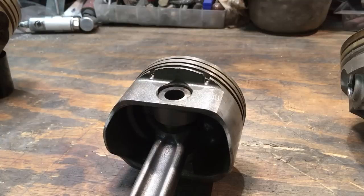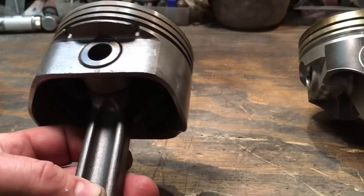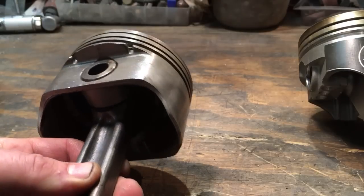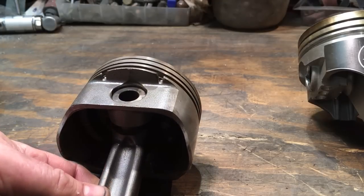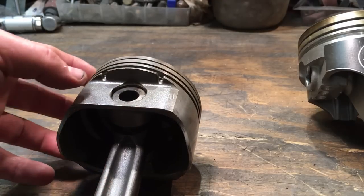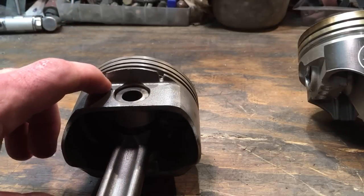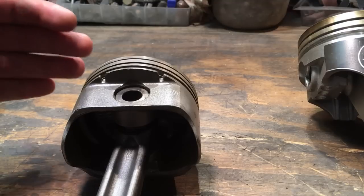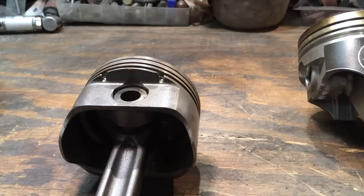I may have to look into this, because I want to make sure I don't run into that problem if I can absolutely avoid it. So I pulled my 4.8 pistons out and was looking at them. I can tell you now that little drain back hole can't be any deeper than it is because it cuts into the groove. It may not be adequate - there could be some legitimacy to that lower support ring covering up the majority of this hole, leaving just a really tiny, small hole that gets easily clogged up with burnt oil from the heat of your combustion process transferring into the piston.